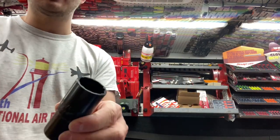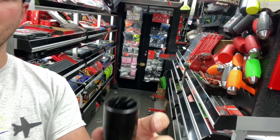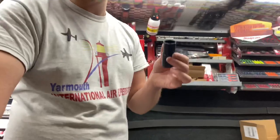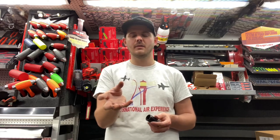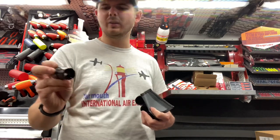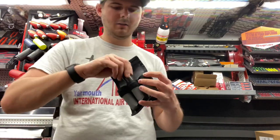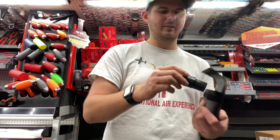It's kind of hard to see, but you can actually see the splines on there. It's more of a fine-threaded spline on one end, and then if we flip them over, they are a little bit smaller on the other end with a more aggressive thread. They're made to take that stubborn chrome alloy cap off of the top of a lug nut, and then you can use the other end to twist the rest of the lug nut off. We've got the three-piece kit on sale — the one I was just showing you is the only standard one in the kit, technically a 19mm or three-quarter. The kit also comes with a 17mm, and this is the biggest of the three, a 7/8 as well.